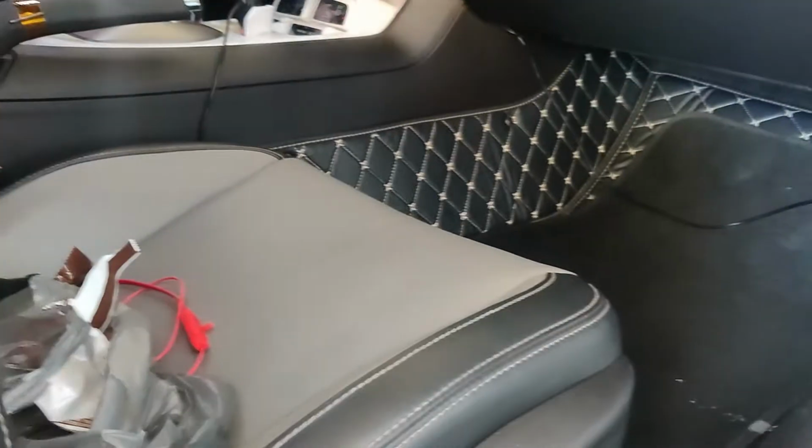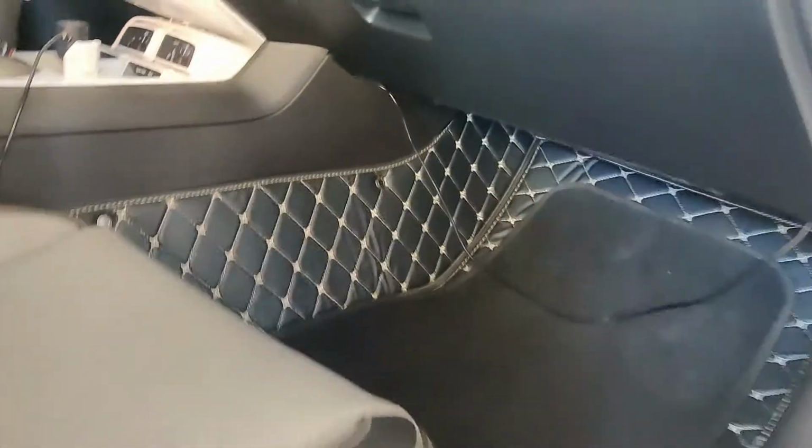side skirt LED strips. Now, if we go under the front lip, where I have the LED strip, I basically routed it underneath my floor mats on the passenger side, all the wires under here. I fed it up through this panel area. It came up through here. So this is the wire right there. Fed it right through there, all the way through the fender, along here, tucked in. And then once I got here, I just dropped it down.